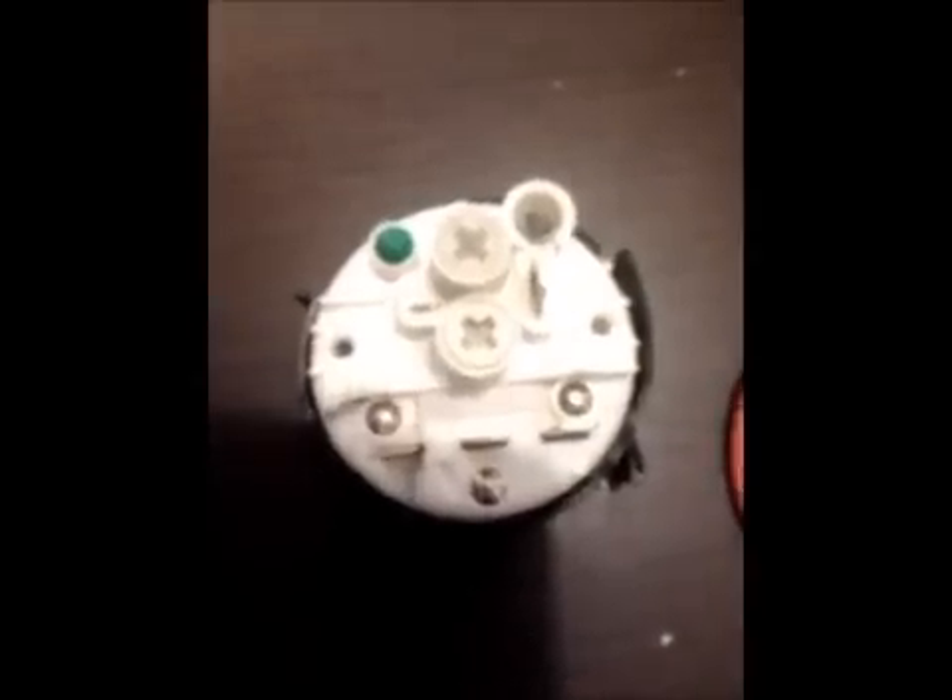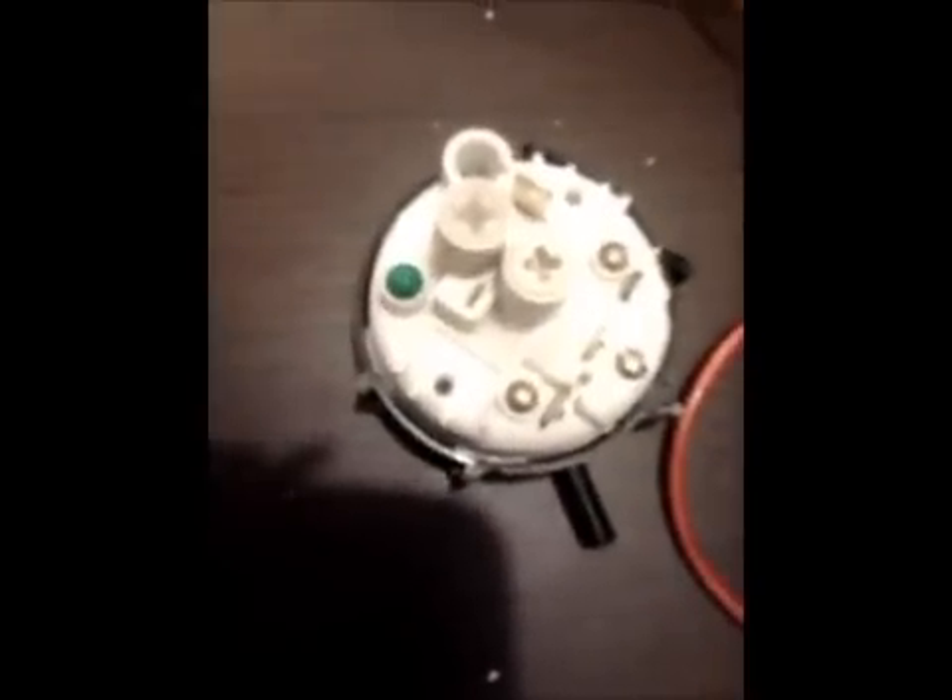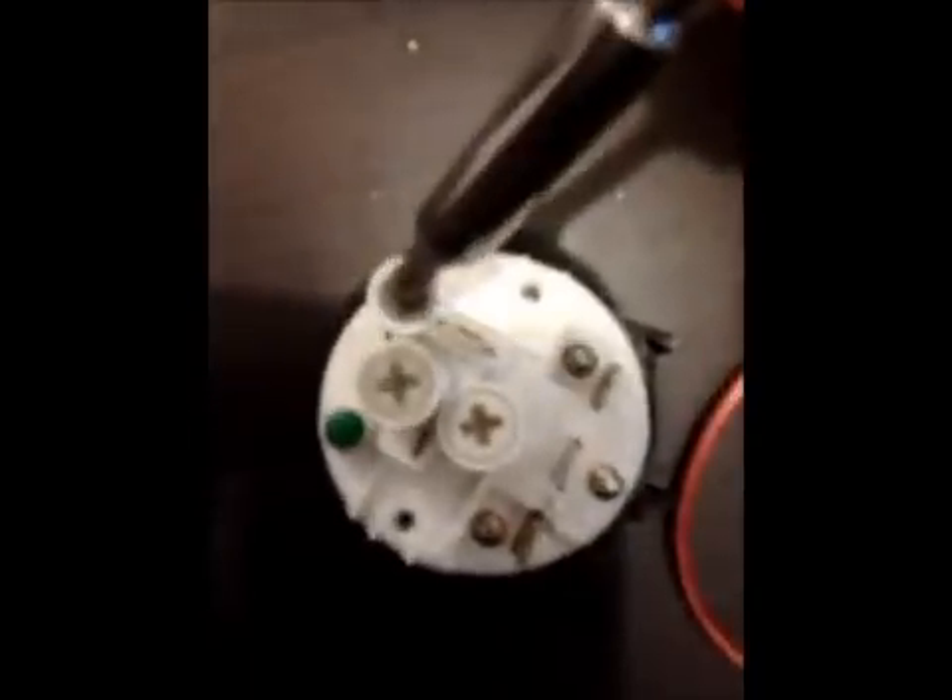The original purpose of mine was to change the water level — to make it lower — because the washing machine was overflowed. So I think I need to only change the middle screw and open it counter-clockwise, and then I think the water level would be lower. I don't think I want to touch the other screws. This one, like I said before, should be kept quiet inside to stop short-circuiting the switch. I'm not quite sure of the purpose of this other screw — it seems like it makes the contact faster. But I found out that the middle one should be the important one.